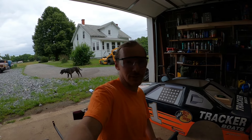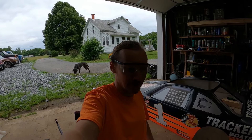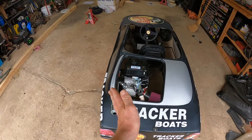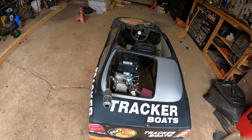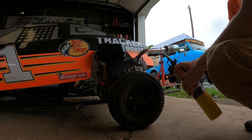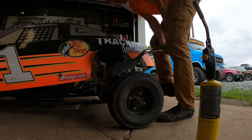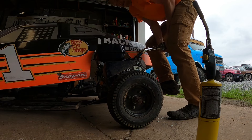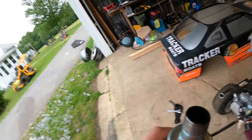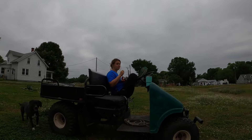It cooks out there. There's only one thing left to make it better: throw the body on. In order to get the body to fit, I need to bend the exhaust inward and slightly up — heat it up and put a pull on it. After looking at it, we're running just a tad rich so I'm going to swap to the medium jet. Now the body's on and we'll rip it.